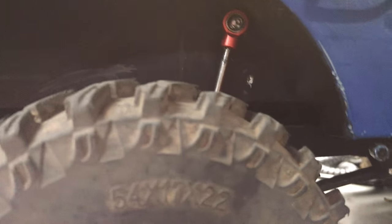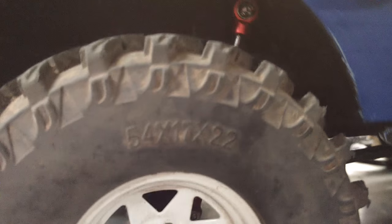Here's the original hole, and now that's about 20 millimeters up — I've moved the shock mounting points. So now even at full compression right here, I still have good travel and more realistic scale looks, and that's where the ride height sits now.